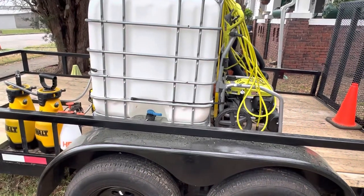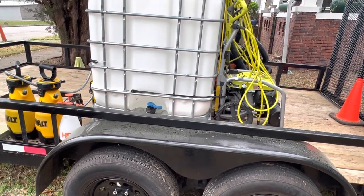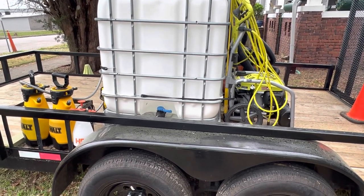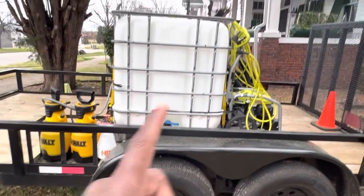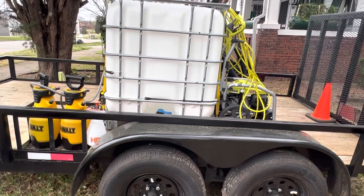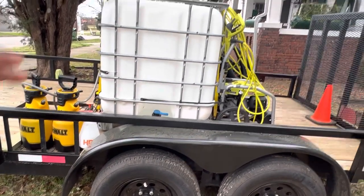In this video I'm going to talk about how I mounted my water tank onto my trailer. This is my setup that is under construction. I have a 275 gallon IBC tote on a 7x14 tandem axle trailer. I made sure I anchored it down over at least one of the axles — I didn't want my tank all the way back. I put it over one axle so the weight can be even and I won't have any trailer sway.